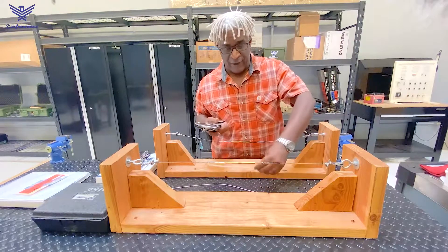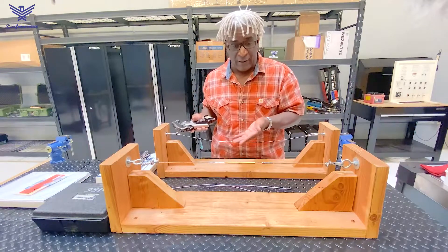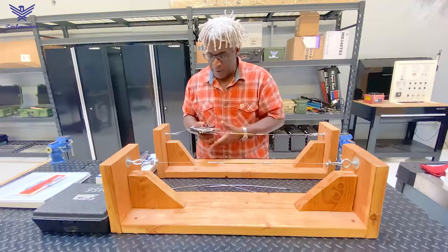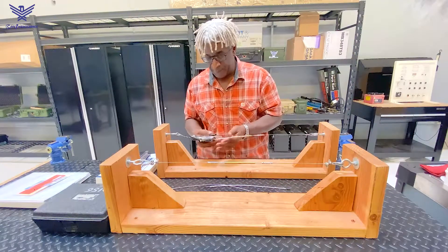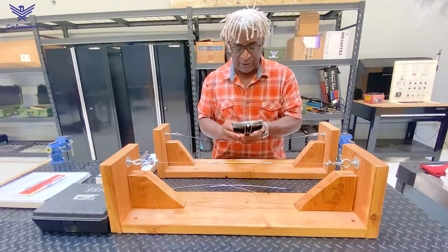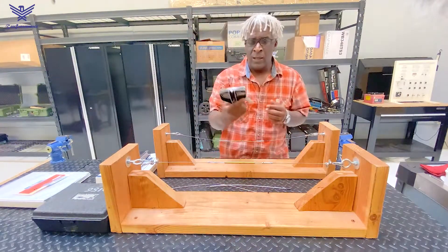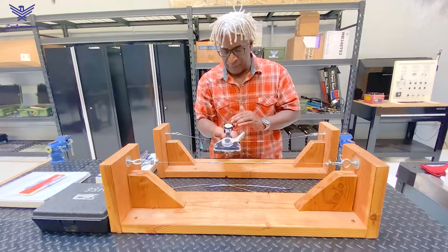In our aircraft application, or for our A&P oral and practical, a task could be to use this tool. I would need to know what kind of size cable. So here I have the slack cable — I can adjust the wheel and I can see that this is a 1/16th cable. Once I determine this 1/16th size, I need to set the dial. As you can see, there's a dial where I can pick because this tool can check tension on multiple size cables.